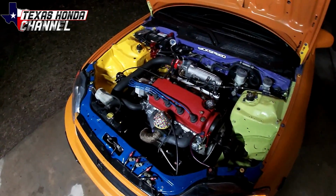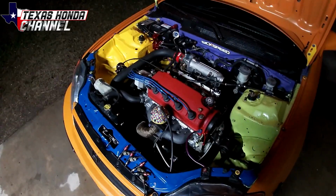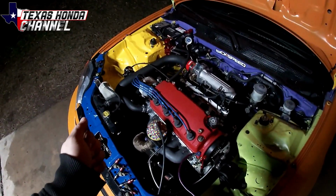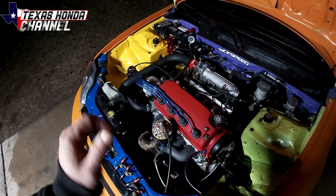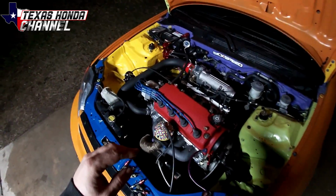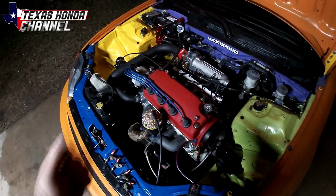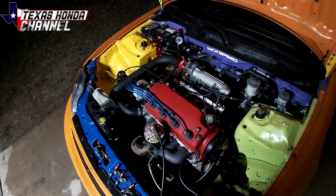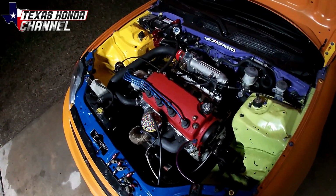The transmission, though, does need some work, because this is the short gear transmission I got from Budget Wrench Apart. It ends up scratching into third gear, even just driving normal, and fifth gear. I also get a second gear scratch whenever I go from first to second. I don't know why it did that. I've got the right fluid in there, so it probably just needs new synchros.